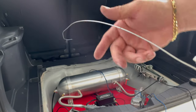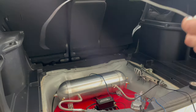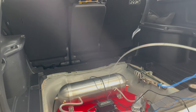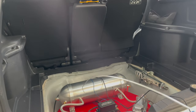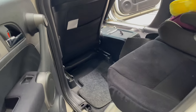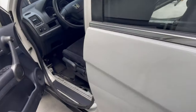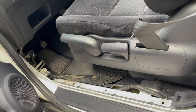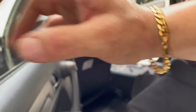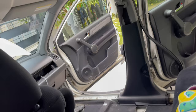I'm going to snake this right now and pass it along — I'll give you a walkthrough on the side of the car. You'll notice I removed a little bit of the panels, and we'll be running on the inside on the left side of the car. This will make life much easier if you remove the seat. On the other side of the car, I removed the front seat so that I can pass the airline hoses. There happened to be a nice hole — a grommet — on the right side, and I could snake it through there really nicely without causing any kinks.